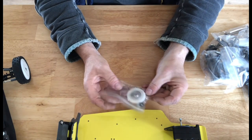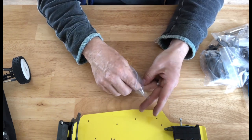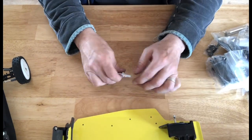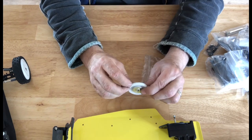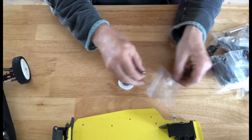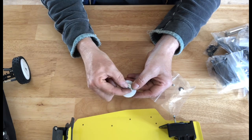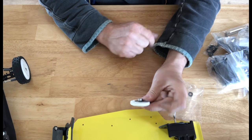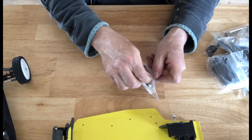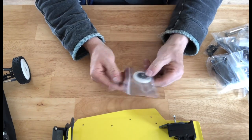The slipper clutch has a pin — there's a little tiny pin which goes through the lay shaft. You then prop your gear on with this slot over the pin. You then have your spring washers, which there's a diagram for in the instruction book — these go over the top, along with your little cap, and a nut goes on to adjust the tension. There is a breakdown in the instruction book from the old Cobra Sport of how it all goes together and how to adjust it.